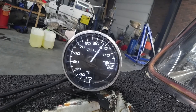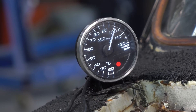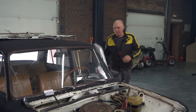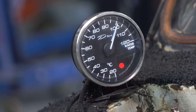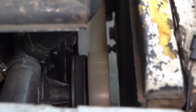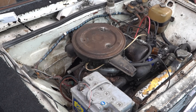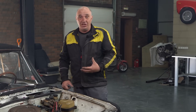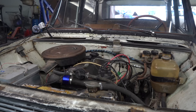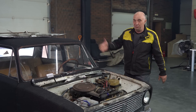The temperature is in excess of 100 degrees, and the red warning light is on — that's how it's calibrated. So what does this tell us? Let me just switch the engine off. Apparently, this sort of system with just the single fan and a radiator without a shroud — this is a common situation. While you're moving, the oncoming air is going to flow through the radiator and help cool it off. But as soon as you're stuck in traffic, the car is going to be jerking around, the engine is going to be under a lot more stress, and so obviously it'll be getting even hotter, to the point of overheating.